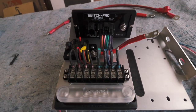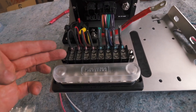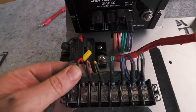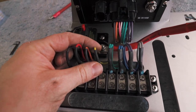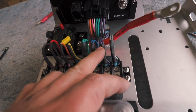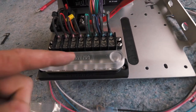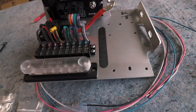These are numbered, and in your Switch Pro manual it tells you which switch goes to which wire. Your number one is a brown wire, two is red, three is orange, four is yellow, five is a double green, six is a double blue, seven is a double purple, and eight is a double gray. We'll be able to hook up our accessories to this side, tie them into the negative, because this will tie into the negative on the fuse block and create the entire circuit.